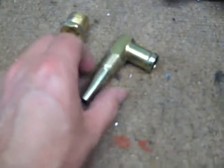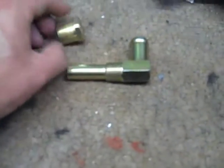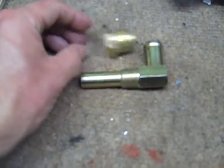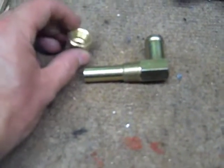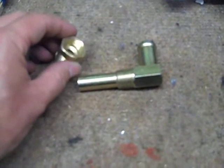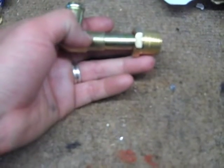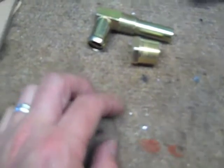Alright, as far as the heater hose from the intake manifold, this thread is smaller. This is the size that I do need. It's an NPT. It's probably a 1/2 inch at least, and it needs to be bushed down, but this is for a 37 degree fitting on the inside there, so this basically has to pass through something like a reducer to get all the way threaded up into here, and it's going to require a trip to the hardware store.